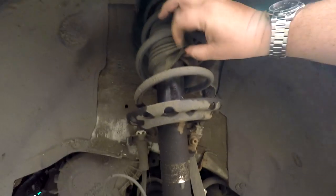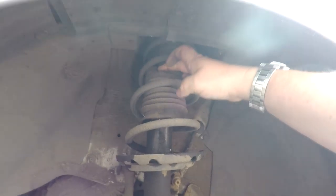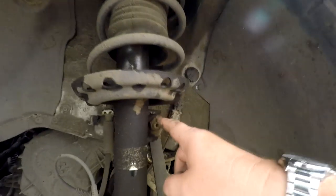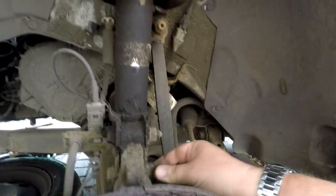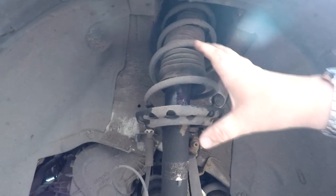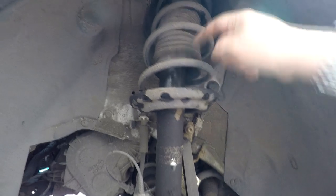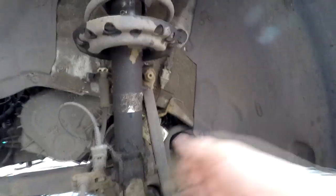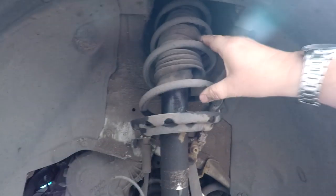Let's show you what we've got under here. I can feel the top of the shock absorber there. That spring is under tension. If I drop this down, what normally happens is you unbolt the drop link bar and these two bolts here - you're able to pull the hub away and this stays contained in one unit. But we haven't got that support there because this has broken straight off.